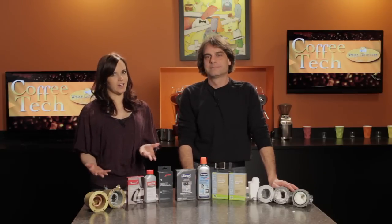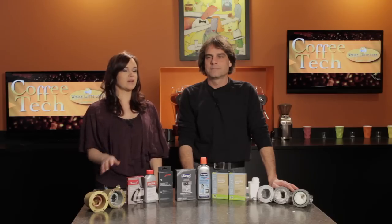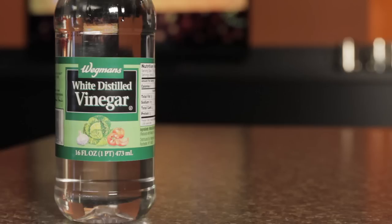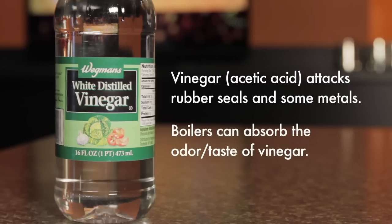Well, a lot of people use vinegar and have for years and think that vinegar is the appropriate way to descale, but there's actually a lot of problems with vinegar. So Mark, why don't you tell us a little bit about that? Yeah, vinegar is kind of the old standby, but it does have a lot of issues. Now, all descalers are acids. Vinegar is acetic acid. And what's not well known is acetic acid can degrade rubber seals and some types of metals. Another problem is that odor and taste. Now, boilers very easily absorb that odor and taste, and once in there, it's really difficult to get rid of.